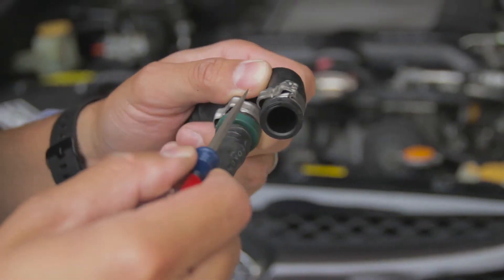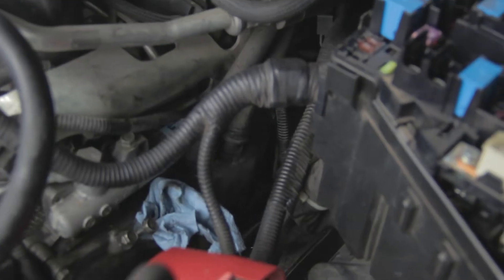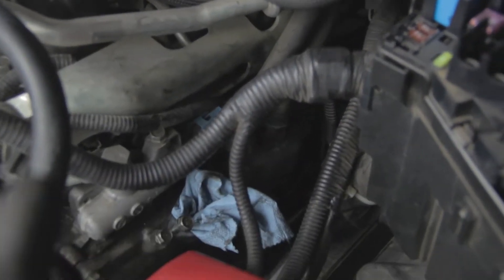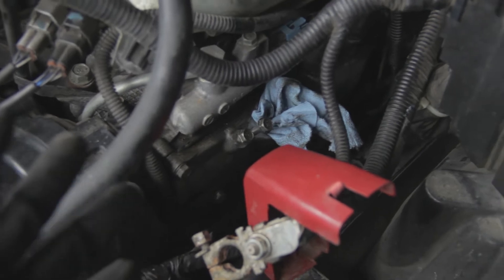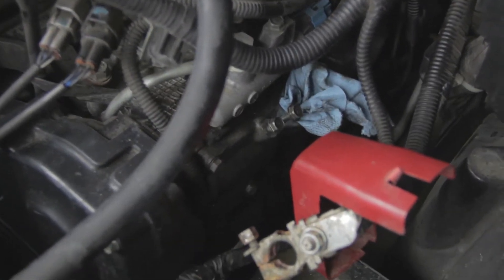So I disconnected those hoses — you literally just pull them up. If they're stubborn, get a little screwdriver and push them up from the front. Don't try to squeeze and pull from the top, because it's like a Chinese finger trap. Then the last bolt that's different is that bolt right there that has to be removed, and after that you just remove the eight bolts holding in the valve cover and it should come right out.